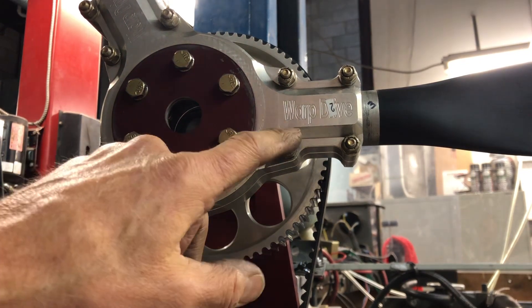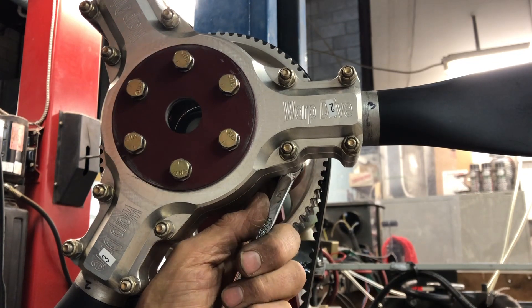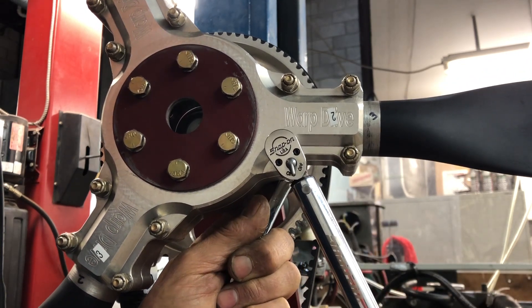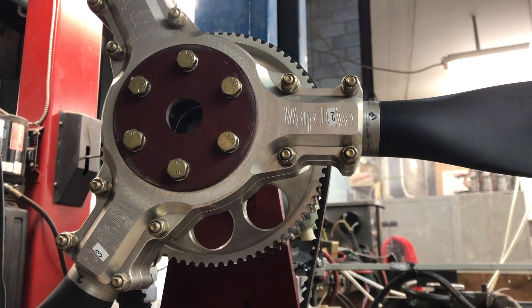If you were paying attention you would have noticed — and I didn't at the time — that the bolts in here were installed backwards: the heads were on the side where the nut should be. That's important because we need to torque it to 120 inch-pounds, and I need to hold the bolt on the back side — I'm not supposed to be turning the bolt, I'm holding the bolt and torquing the nut. I ran them all out individually and flipped them around without having to take the prop back off, then rechecked all the blades — the pitch is still exactly where it was supposed to be.